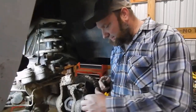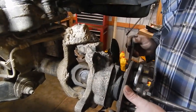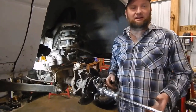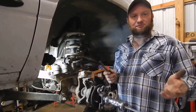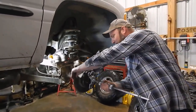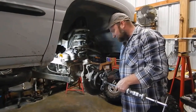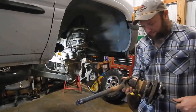The next thing is taking this bearing hub assembly out. You can take your chisel and hammer, put it in between there, hit it, and work it from side to side to work the bearing out. Or you can take a slide hammer — I've got a slide hammer and this is an easier way. I put the slide hammer on and just the weight of it actually shifted the bearing, so it's not going to be any problem getting it out. Just take your slide hammer, make sure you don't get your hand in the way. See how easy it just popped right out. A lot of times these may be rusted in there, but this one is in good condition.